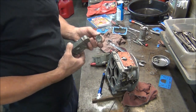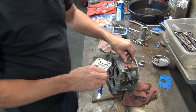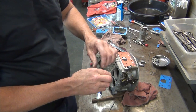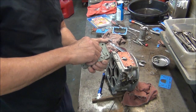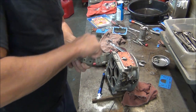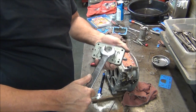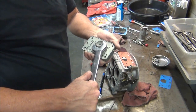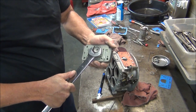Now, since this is a drag car, of course, for those of you who follow my channel know that, I don't use a power valve. This is a power valve block off. But you still got to have a good gasket under there. So we're replacing that. If you want to do away with the power valve, they claim, whatever jets you were using with the power valve, you want to jet it up about three, maybe four sizes. Some say five.